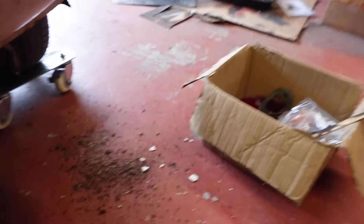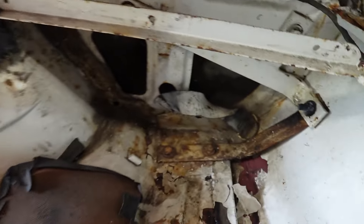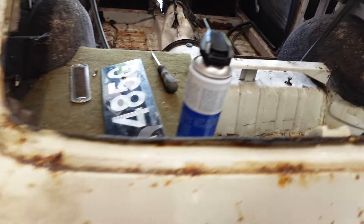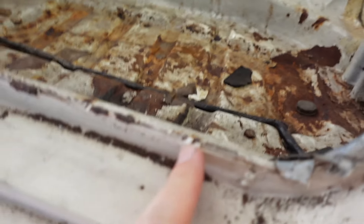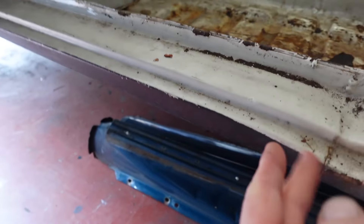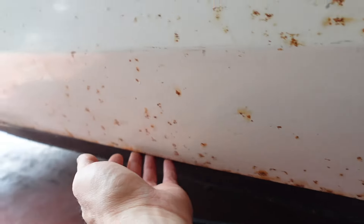I've been having a bit of a poke around and this one's a bit crispy looking. It's turned out to have more work than I thought - there's a blob of what's probably weld there, this lip's actually been replaced. It's making me wonder whether they put a new boot floor in given the distortion and the uneven repair around the edges. And this sill must have been done as well, because if you look you can see these are stitch welds. That door's shut but it's a little bit proud, so there's some work to do there.